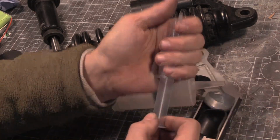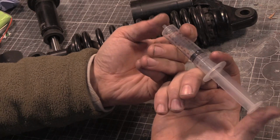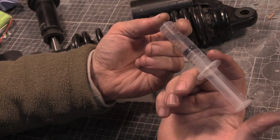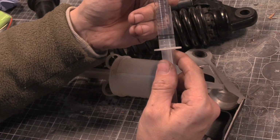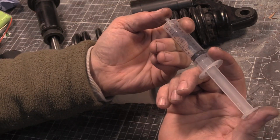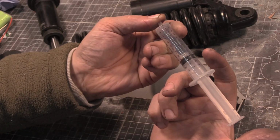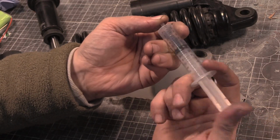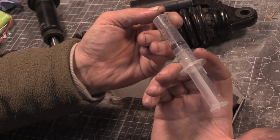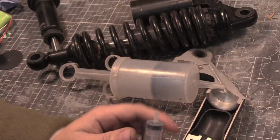So this is a bit more sealed. Yeah, so you see there, that is a type of suspension, just using air. And we can even measure the stroke on this. So it just sits at 10, we'll start at 10. We'll give it some compression to 2 and it pushes back out pretty much to 10. It's probably got a bit of leakage somewhere, but that is a spring. And if you look, it's not oscillating, it's not bouncing around.